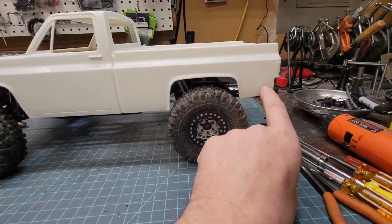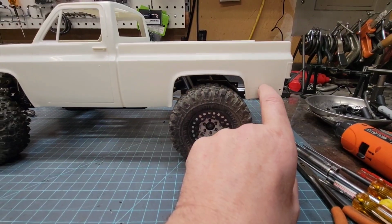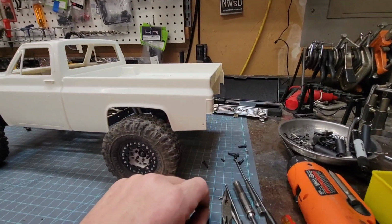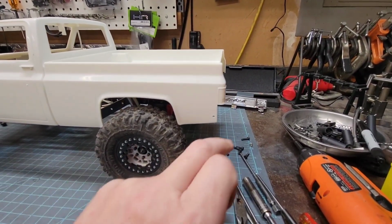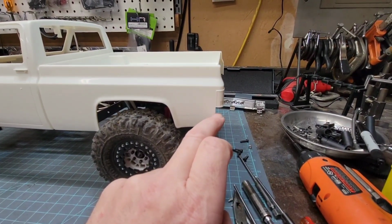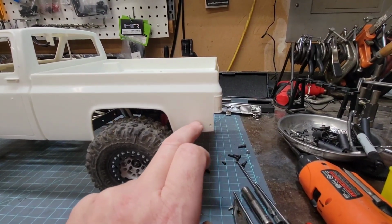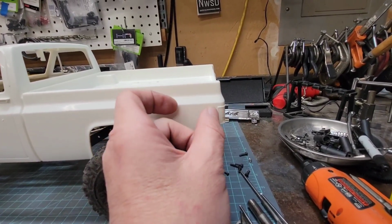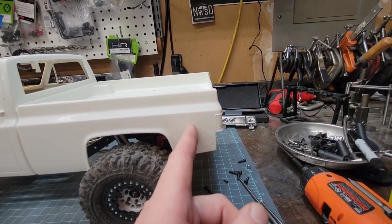In the back also, with the body requirements, you're able to trim the lower behind the rear wheel well up to the bottom of the tailgate. Now I don't have a tailgate on this guy yet. Everybody's out of stock. But what I do know, looking at pictures online, is the tailgate actually ends about a 1/4 inch below this light bezel. So I just measured down 1/4 inch, and I'm probably going to have him hack it off there, maybe at an angle. But I also got to remember this is going to get bobbed. So I'm going to cut this and move this back here as far as I can get it.